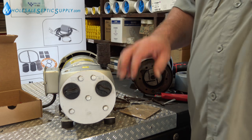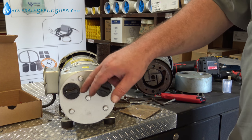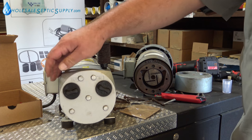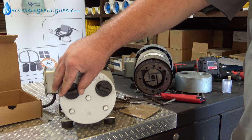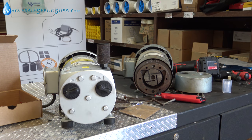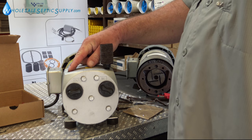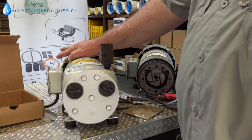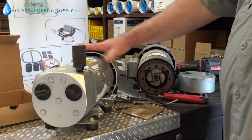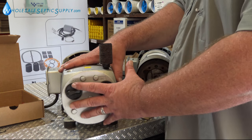You don't really want to fool with the O-rings — they'll get old, get brittle, and blow out eventually, but you can take one out and put a new one in. Keep the filter clean. This is your outlet. Don't fool with anything in the back — this fan does not need to be removed. No part of the rear end needs to be touched at all. Only the front end, which is the pump part.